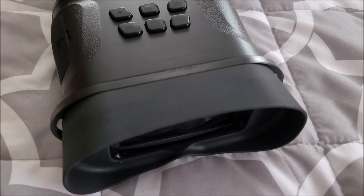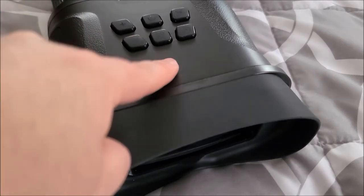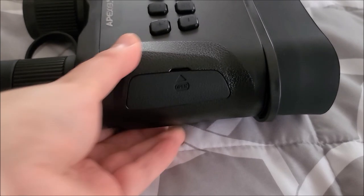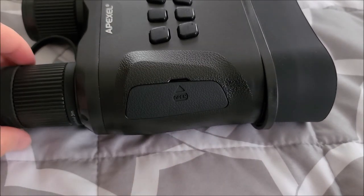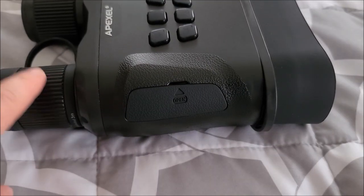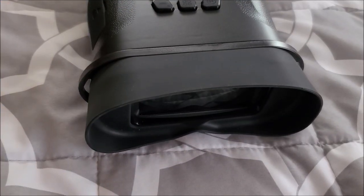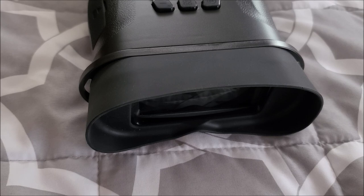So I'm going to take a picture of it pitch black and then open it up in an image editor on my laptop. If those pixels are still there, then that means they're actually on the CCD. If not, then it means it's actually the LCD. There are some stuck pixels. So yeah, I'm not too happy about that. But if it's on the LCD, that's preferable, because at least then your pictures will come out clean. Or it could be something weird going on with Gaussian noise or something within the CMOS sensor. I keep saying CCD. It's CMOS.